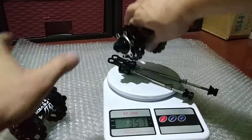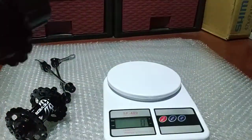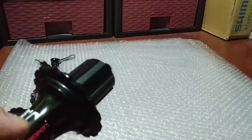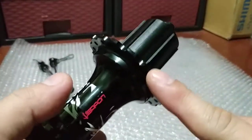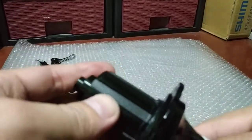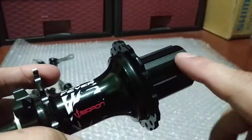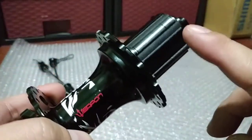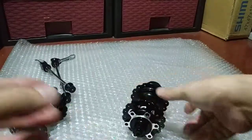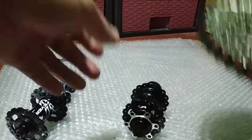With the skewers, we have 512 grams — still quite acceptable for this kind of hub. They are, I think, made in Taiwan. Also, before we go — this is compatible with 6 to 10 speed cassettes. You heard that right: this won't work with 11 speed. I tried 11 speed on this and it doesn't work — it's only good for up to 10 speed.